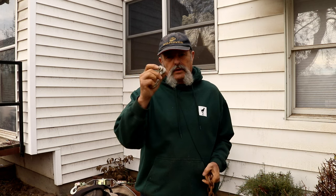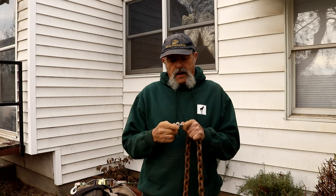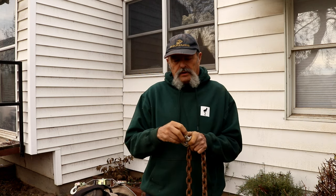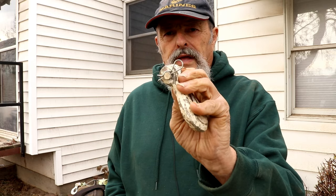Make sure all your hooks have pins with cotter keys so you can pop them off really easily — if you've got to shorten it, move it to a different spot, or if a chain breaks you can just pop it off, put it on the chain where it broke, and you've still got a chain. You don't want the ones that are hammered on with a rivet or bolted on, because you may not have the wrenches to undo them. Use a cotter key or locking pin to hold it in there.